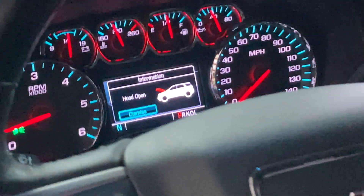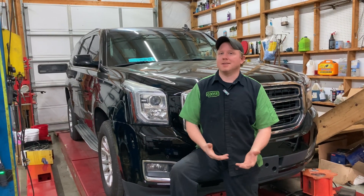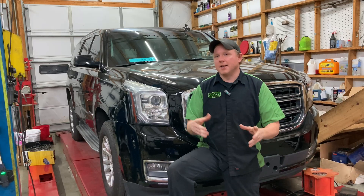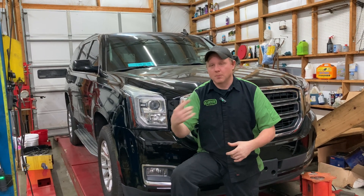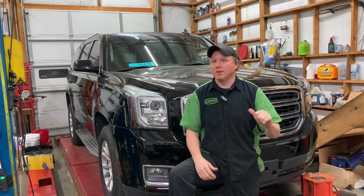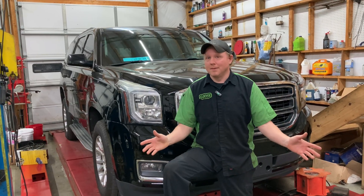So that's going to wrap this one up. A couple notes: when it comes to programming, we don't do a ton of it here because we're typically working on 10, 15, 20 year old cars, but we do do it. They're all a little bit different but basically doing the same thing. On a Toyota it would have automatically done any initializations and prompted you. GM is not that dissimilar — just a couple of extra steps. Basically everything to program, except for Chrysler, is not that difficult.